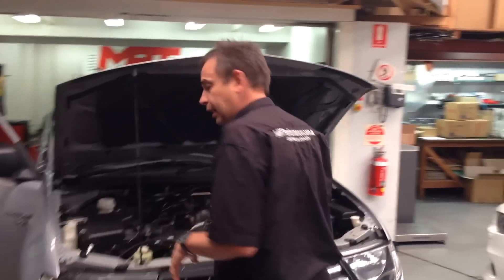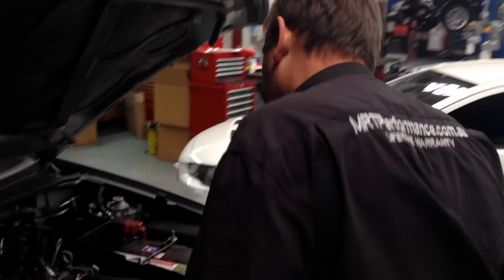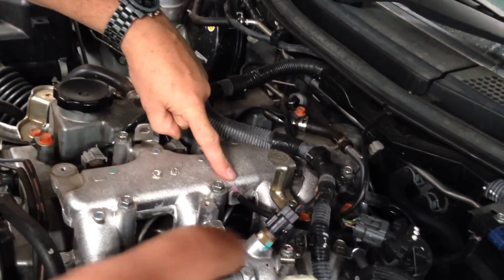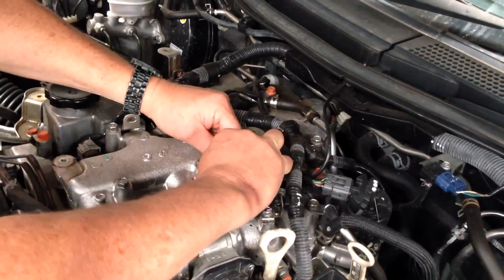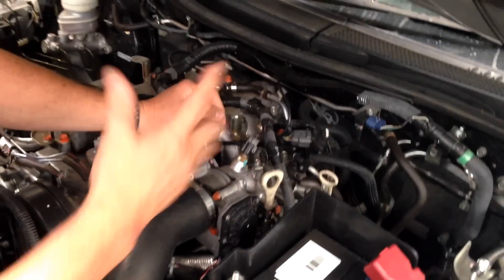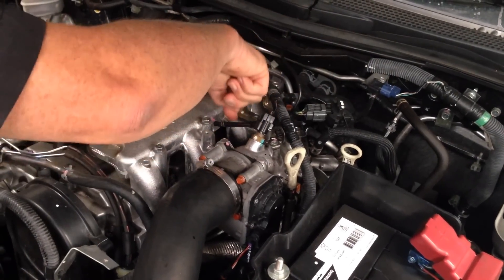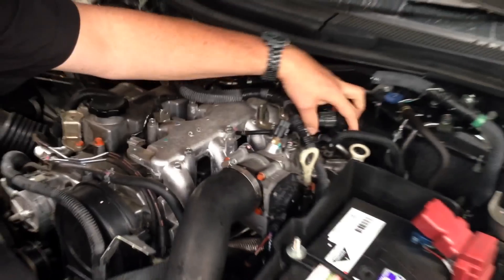Now this particular car here is the 2.5. You'll notice on this one the MAP sensor is on the inlet pipe here, the EGR valve is here, so all the soot is in this part of the inlet manifold. This particular pipe here — I can't quite pull it off but I know because we've had it off before — has been blocked and was causing all sorts of weird performance problems. The later model of this 2.5 Mitsubishi have relocated the MAP sensor pressure port to this little casting part on the inlet manifold, which you'll notice is before the EGR valve.